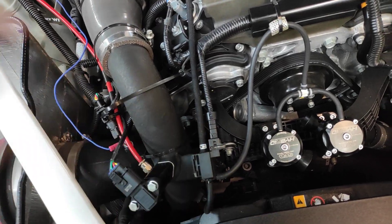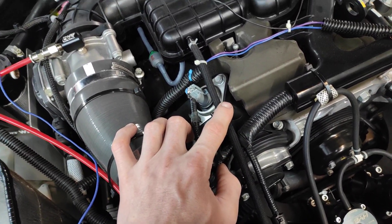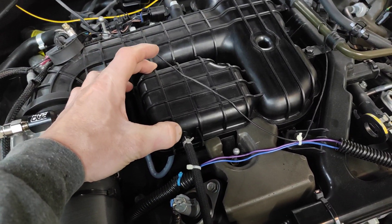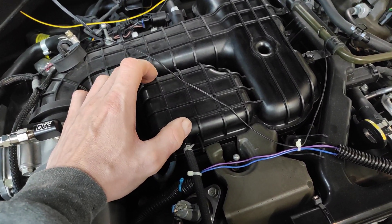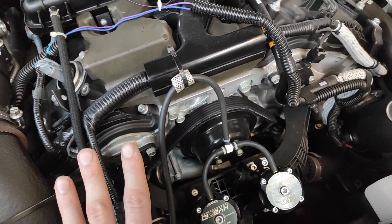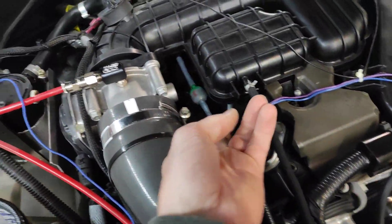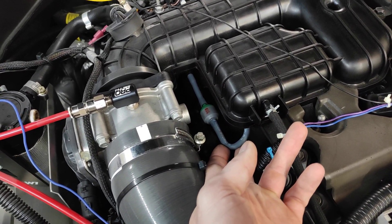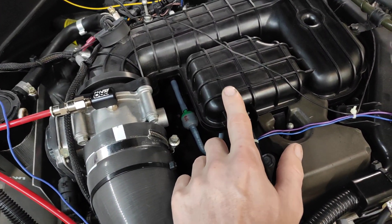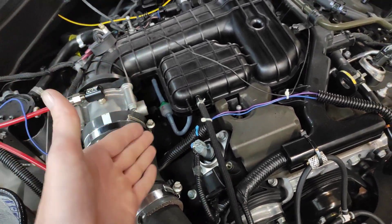The reason this one is only vacuum and not plenum pressure is because it comes up here to a little chamber that keeps a bit of extra vacuum so that when the solenoid switches, it has enough vacuum pressure built up to pull up both stock blow-off valves. This little thing with the green on it is a check valve — it only allows vacuum to come through and does not allow boost to come through, which is why this is only a vacuum line.